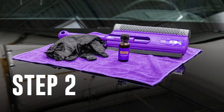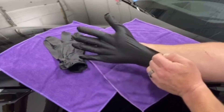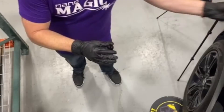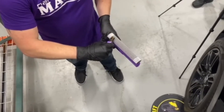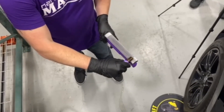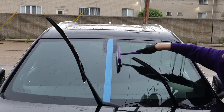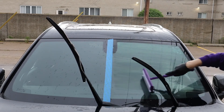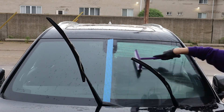We're only going to treat half of our windshield to show you how it works. Put on your gloves — don't skip this step. Then pour the contents from the small bottle labeled Bottle 2 across the entire sponge side of the squeegee. Once the sponge is saturated, rub the solution all over your windshield. Make sure you get into each corner and don't miss anything.